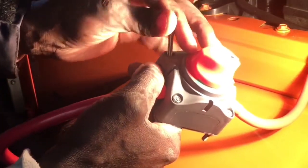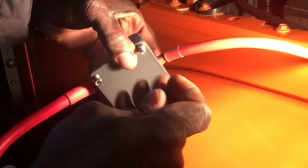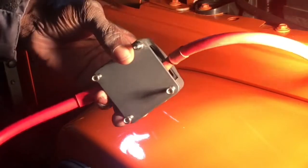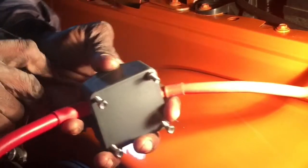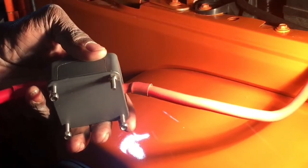So it's really just taking the bolt, it's an Allen wrench style, slipping it on through. And these are threaded nuts right here. Got the threaded nylon up in there to help keep it on there and not slipping off. So no need for a lock washer. And so I'll just take this, hold my Allen wrench on it, and then it takes an 8mm on this side, and I'll get that all connected up, and then we'll connect it to the battery.